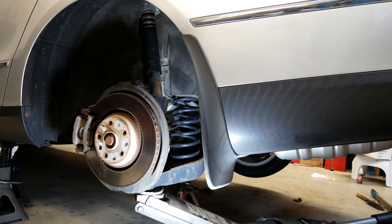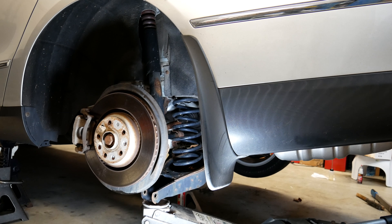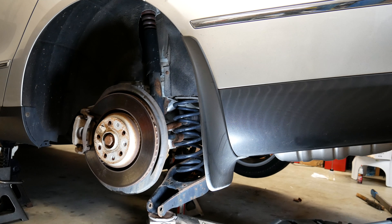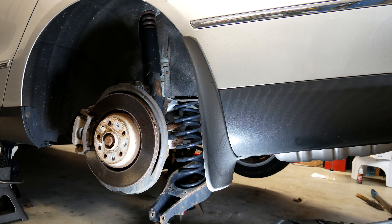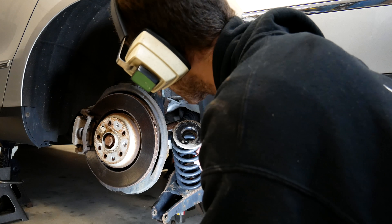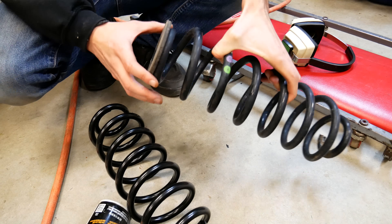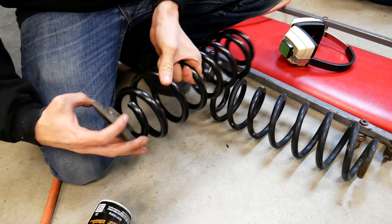I carefully and slowly lowered down my jack in a nice controlled sweep. Once again safety is number one and these springs could do a lot of damage, so be smart and be safe when you're working on any job like this. Once your suspension arm is low enough that there won't be any pressure left on it, you'll be able to get the spring out of the rubber spring perch that is in the suspension arm. This will just take a little bit of pulling and tugging and it'll pop right out. Next we can get our replacement spring ready to go in. If you're reusing the rubber part you just need to pop that off and it'll press right on to your next spring.